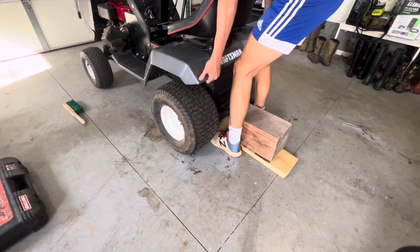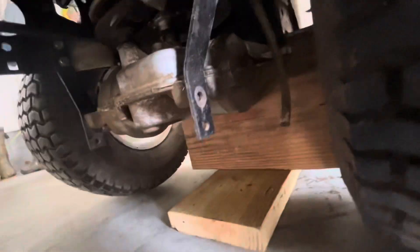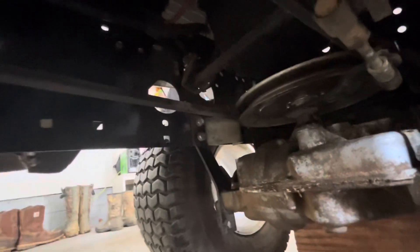There is so much grass under this mower - so tomorrow I'm definitely going to be cleaning. The top pulley - I don't know, it's probably like 11 inches or something, it's absolutely massive. This pulley is the one the belt is on at the engine and it's probably about a third of a rotation. I'm going to put like a one-inch pulley on here, so I need to take the axle off to get to it.